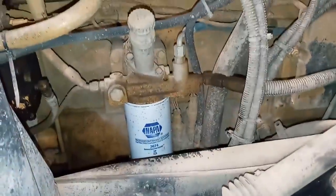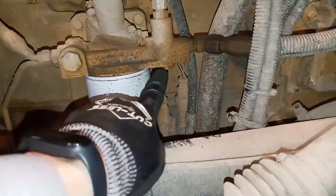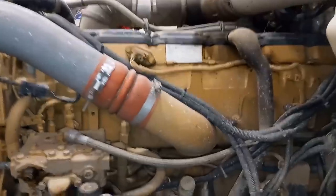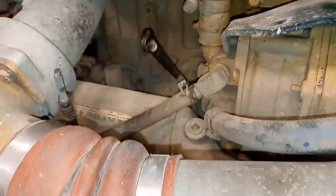The smoke seems to go away when it warms up a little bit. The first thing I like to do is look at a few things. What I'm looking at here is the fuel pressure regulator — looks like it's original. It's got newer filters on it, looks like original harness here. We're going to go on the exhaust side and check the oil level, anything with the exhaust, see if we can see an exhaust leak. The wastegate looks totally factory there, with a bolt in the wastegate.